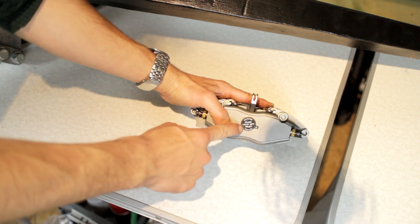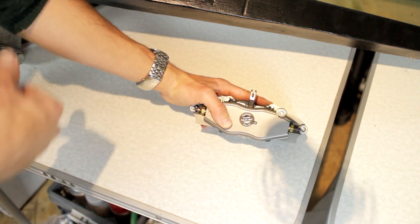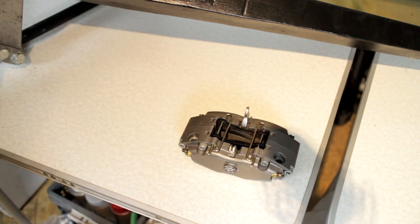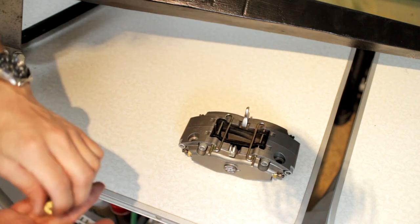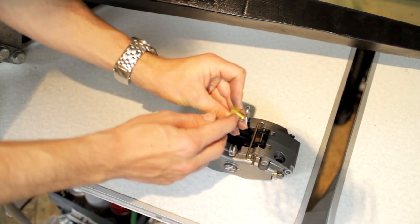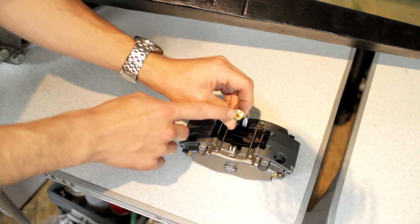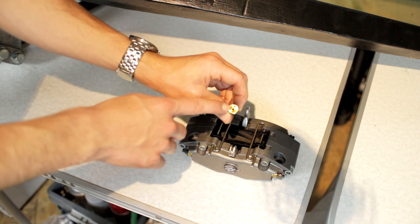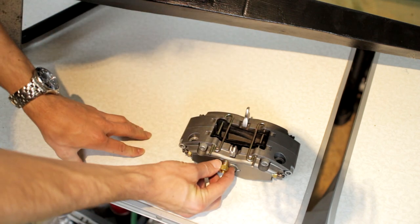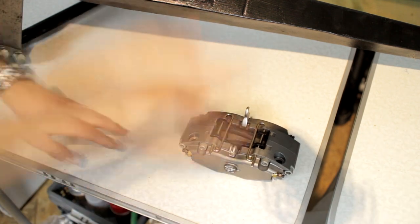The input into the caliper is a 1/8 MPT fitting. However, you don't have to change your brake lines — you're also running a hard line to the caliper because the flexible line is on the front of the radius arm. You can use a 1/8 MPT to 3/16 UNF conversion fitting, so you can use the original brake lines when you screw in this conversion.